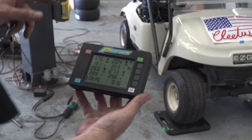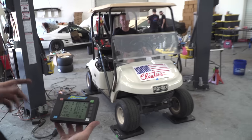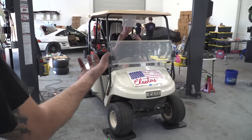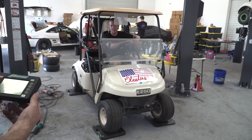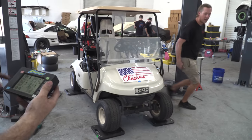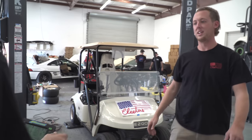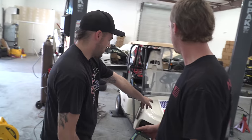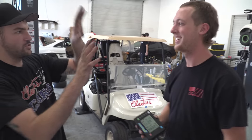The front though is what we're gonna have to address because it's 30 pounds heavier on one side of the front than the other. Yeah, but I'll have another 20 pounds of gear on. Yeah, but you're behind that center line, the instant center. So we're gonna have to address that front because look, when you get out, it drops even more. It's a 40 pound difference. So we'll have to hang just a little bit of weight off this front corner, so when it does snatch up, it doesn't do one of these.